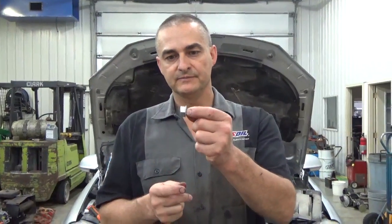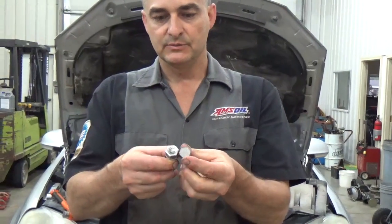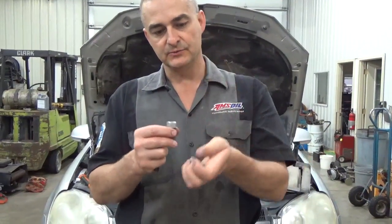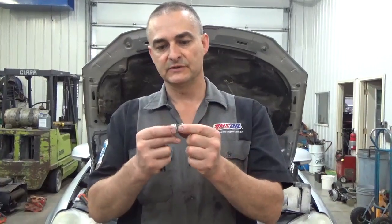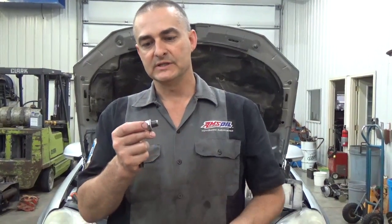The head is a little bit longer and a little bit bigger in diameter, but not by a whole lot — it still fits in there. There's kind of a ridge around where that plug goes in, but it fits well and I can get a wrench on it and snug it up good. The thread insert probably isn't quite as robust as it was originally, but it'll save you a whole lot of money from having to replace that oil pan.